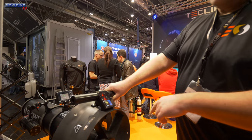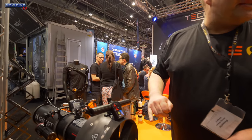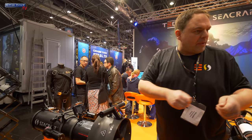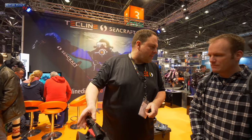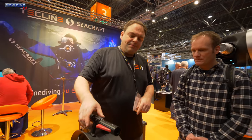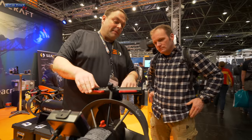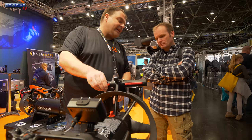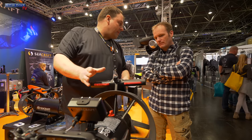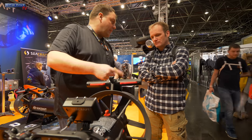Yeah. And then I can program the time when the scooter falls back to gear zero. For example, if I have to do something with a line or so, to avoid unintended starting. Now it's doing nothing. From zero, with a double click, I can go to the last selected gear and start again. Then I wait my 5 seconds, or I decelerate.